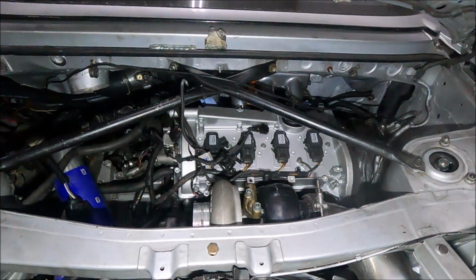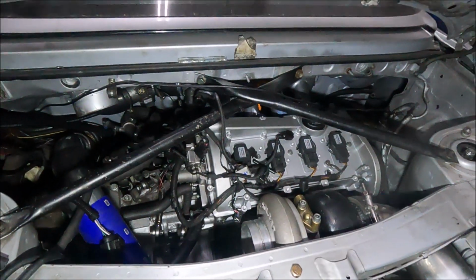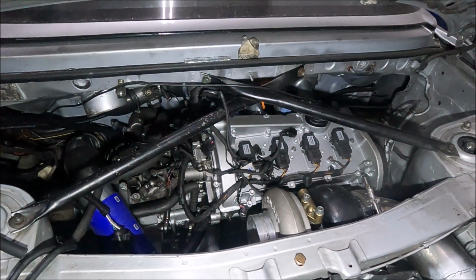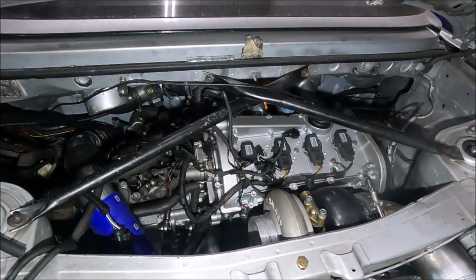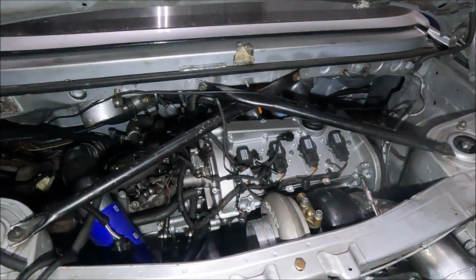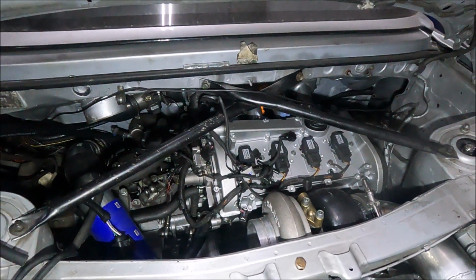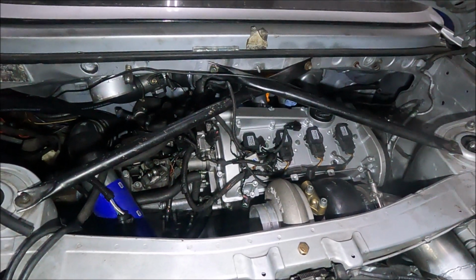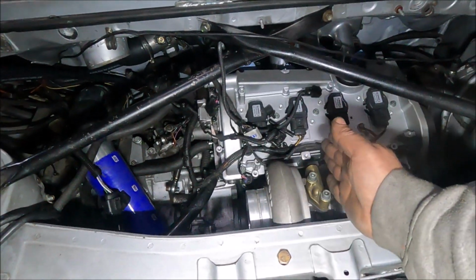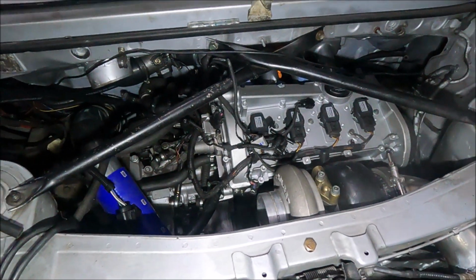But I kind of want to get hold of the pipe first and work it out, because what I've bought is because the standard hose is mostly solid metal, and it's got some slight flexi braided bit at the one end. The one I've bought is an OE replacement, but braided the whole way. And obviously the OE oil feed is a similar place, but lower down, because obviously it's a low mount turbo.